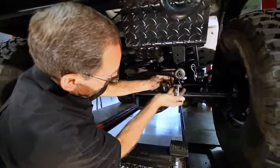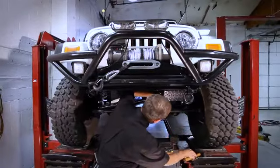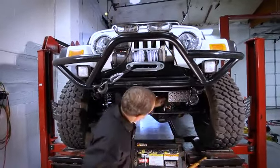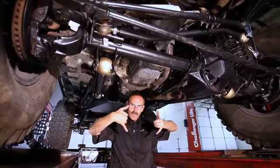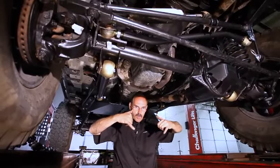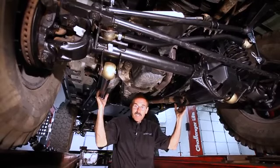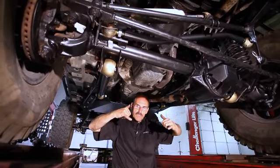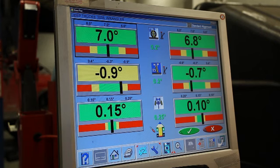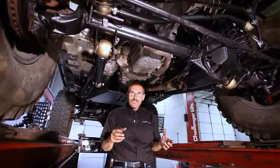We'll leave the washer on it. Slide it up, put it into position, use a soft hammer and just tap them in. Now that we've got our track bar set, let's take a look at our caster. Our caster angle is actually measuring the relationship of the upper and lower ball joints to one another. As our wheels pivot on those ball joints, if we have positive caster the lower ball joint is going to be ahead of the upper one — and vice versa, it will be negative caster if that lower ball joint is behind. We're going to shorten these lower arms and bring those ball joints back in line with each other. We want to keep as much positive caster as we can — usually around four degrees, three to four degrees, depending on how big the lift is.